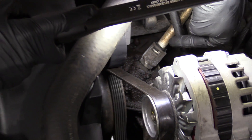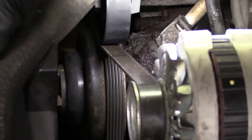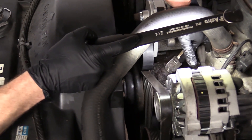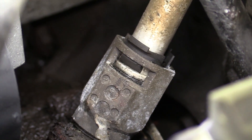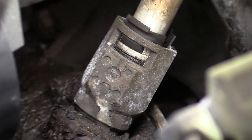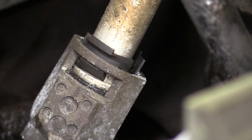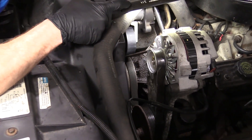Continuing toward the front of the engine, you'll see the water pump with a pulley that leads to the serpentine belt and likely has the fan mounted to it. Any coolant tube leading into the water pump is a potential leak area. If you shake it around and see moisture inside the seal, that's telling you it's leaking for sure — and if everything looks very wet, you don't even need the pressure tester to confirm it.